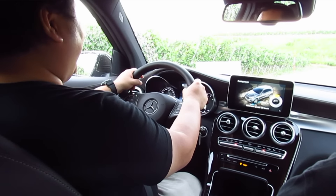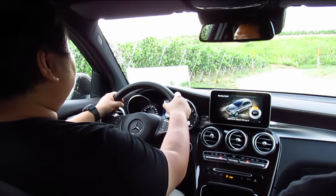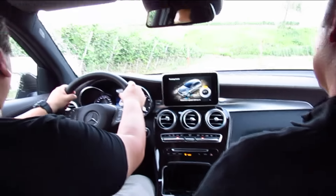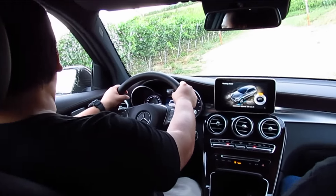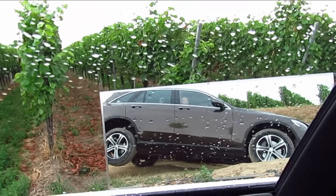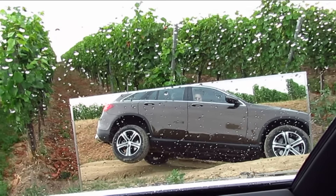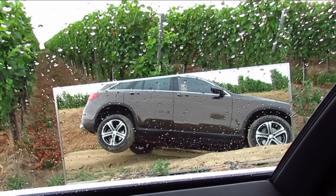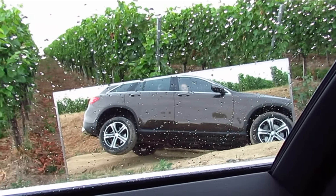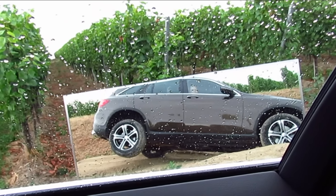So enjoy. Steer just straight. Very deep. And to the right. Slow. Lose the brake a little bit — get the car stuck in the hole. Lose it. If you lose the brake now, lose it completely. And then you see the spinning wheel — it's turning. Just push the pedal a little bit. Four ETS is building up pressure and the car starts to roll.